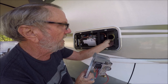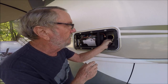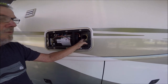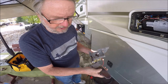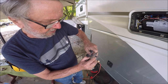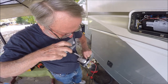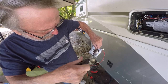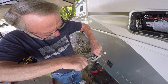Turn the gas off and loosen the plug. The gas orifice goes behind the burn assembly. This part goes next to the igniter and you have two screws in there. With a nut driver, start the screws loosely — don't tighten tight right away because it can cock — then tighten them down good and tight so nothing loosens up.